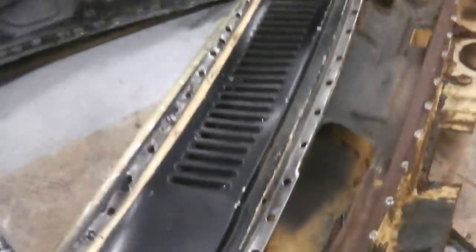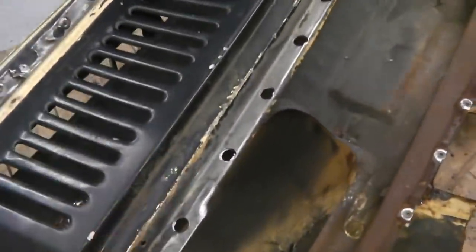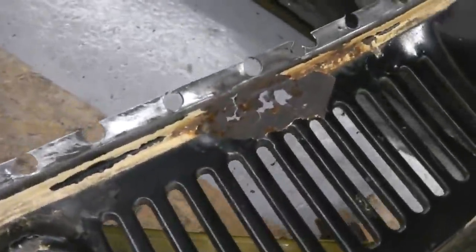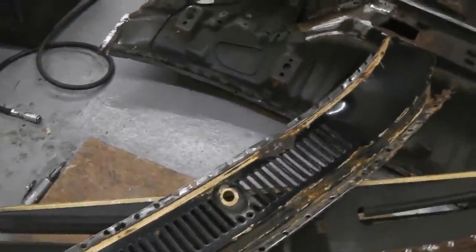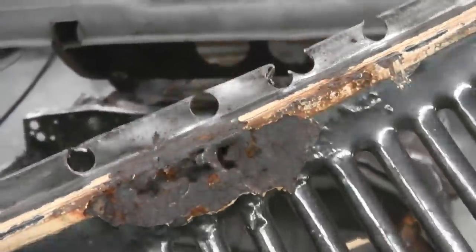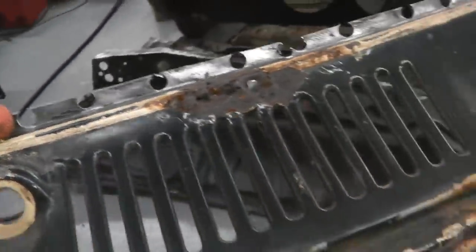I think, you know, we did the best we could there. We saved that. Yeah, I mean, I've saved this. It's not dented or damaged, and it could be repaired, because we fit two new scuttle ends to that, and then a piece could be grafted in there off this donor section that I've got, so I can make that into a new scuttle. So that's a good little piece to keep and save. We'll make that into a nice new piece. Easy to get that fixed, just cut and shut there. So good that we've saved that.